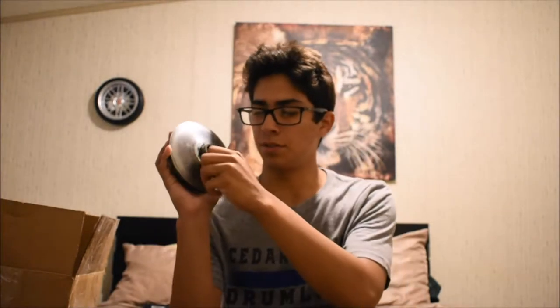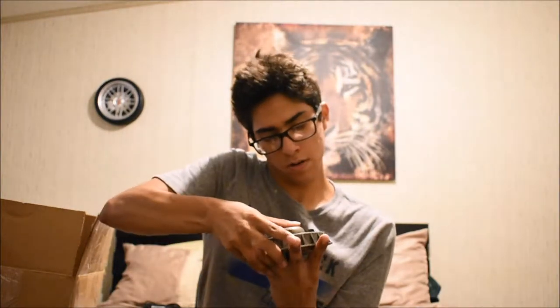First let's look at the driven unit. Here's the old one — it's quite a bit rusted, has a whole bunch of belt on it, and there are a lot of nicks and scratches which will cause premature belt wear. Right here you have this sliding piece that does not slide at all — it should slide back and forth pushing these rollers, but the pin on the inside and the rollers are quite a bit worn, and it's very dirty.